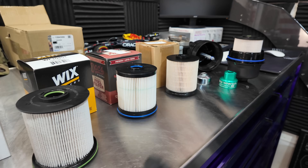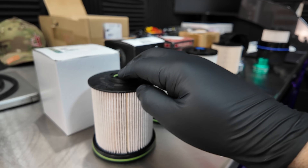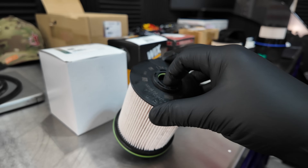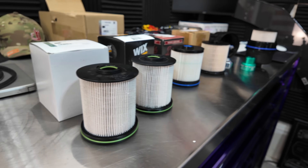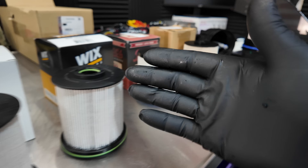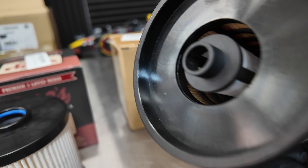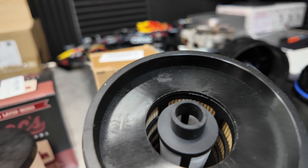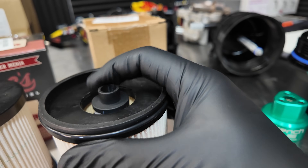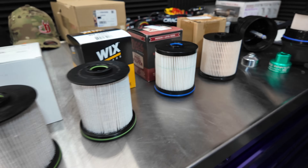Hopefully this video helps you out on deciding which fuel filter to get and just what to look for. This AC Delco is what I run — it's totally sufficient. Don't listen to anybody that says these are not sufficient. Yes, they run them on the cruze, but they also run them on the 6.6 Duramax diesel, and I see a lot of trucks out there doing just fine. Get a genuine AC Delco one or any one of these that you prefer — not the cheap $10 one. Some people may be okay running that super cheap stuff, but it's missing one of the most important critical components of the fuel filter, it's loose inside, and that's going to let water pass through. This is just asking for trouble. Please take my warning. Until next time.